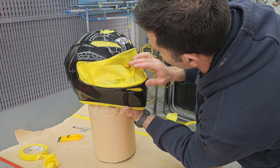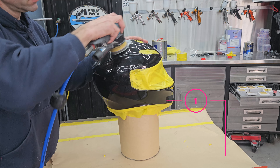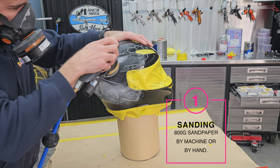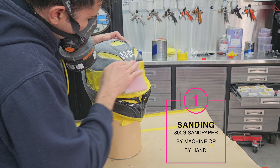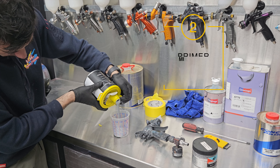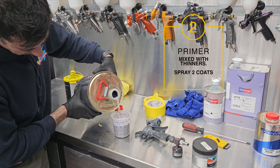I'm not too keen on removing these parts because I'm just not confident they're going to go on the same as they were before. Because it's a glossy surface, I'm going to sand it. I'm using 800 grit sandpaper on this machine. I've also got a little interface pad on there to help with the curved surface. Finally, I'm going over with a sanding sponge just to etch up that area to make sure the primer can stick.